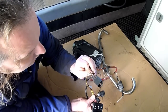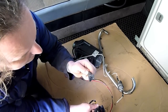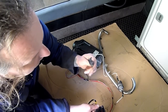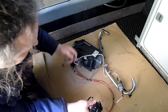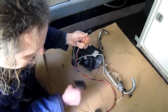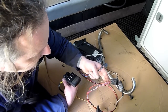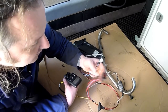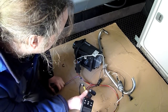Out of that big bundle you need the thick red live feed to the heater control unit. The brown one is the neutral, and this one here goes to your pump - which is pretty obvious because you can see where it connects. All the other wires you don't need; they're for Transit-specific stuff incorporated into the loom but not of any interest to us.